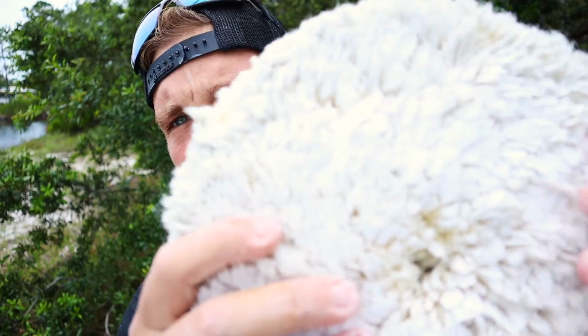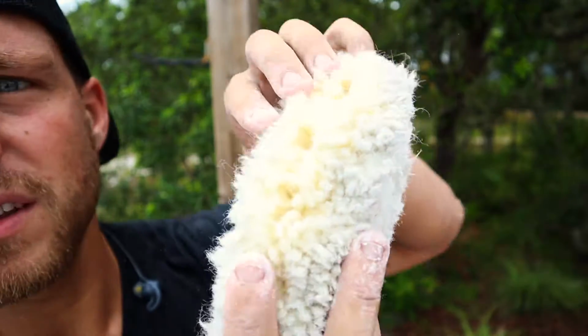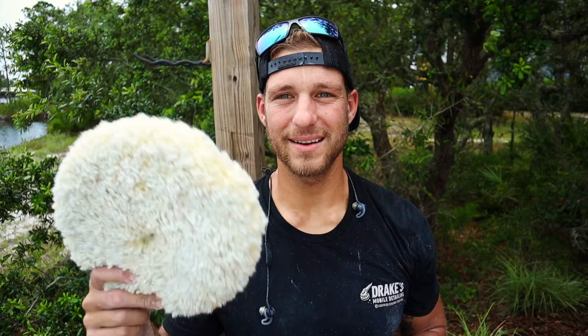Let's stop the video real quick. I noticed that my buffer was kind of bumping, kind of grabs and bumps and twists on you like that. That's usually a sure sign that your pad needs to be cleaned. I don't know if you could see the pad pretty matted on there. It's supposed to be fluffy, like the sides right here, but it's real matted. You see how matted that is? So what we want to do is clean it. Let's go ahead and knock that out.